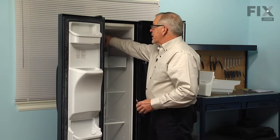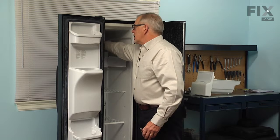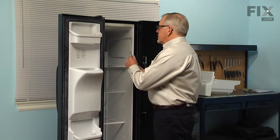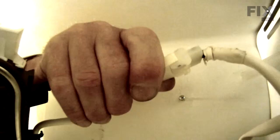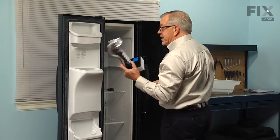We're also going to want to remove the ice maker. Depending on your model, there may just be two mounting screws on the side or there may be a third one below at the front. Using a quarter inch nut driver, start by removing that. The two screws on the side wall just need to be loosened — they don't need to be completely removed. Just lift up on it, lift it away from those screws, and pull it forward enough to disconnect the wire harness connector, then set it aside.